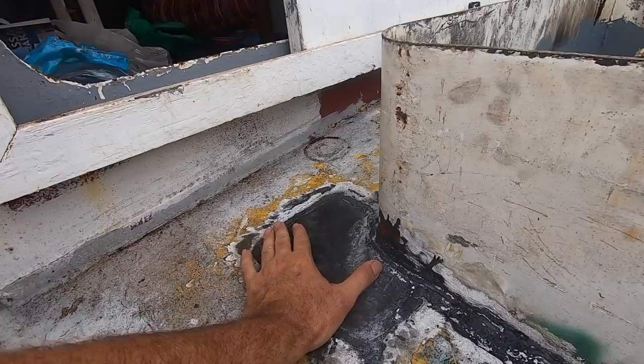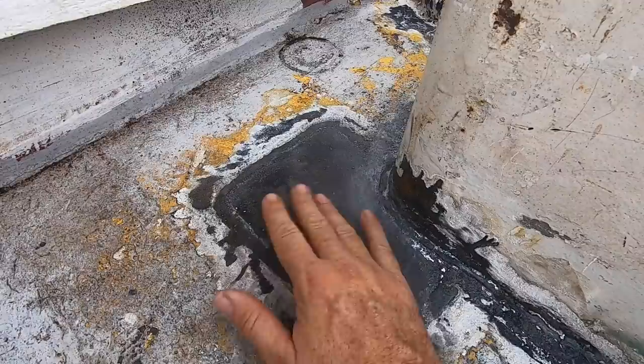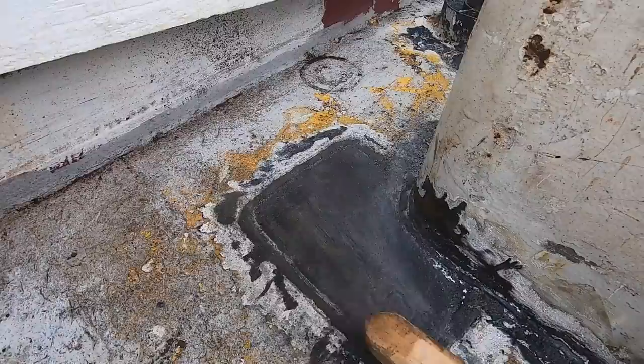See that water down there? That's rain — finally got a little bit, not a lot, but still rain water. All these patches, I've now put some phosphoric acid on — they rusted pretty quickly, so I just put that on to treat the rust. I'm going to brush this off with a hand brush; I want to leave the iron phosphate that the phosphoric acid converts the rust to, because it's actually pretty good adhesion to the steel.